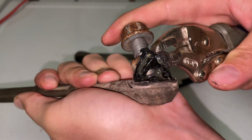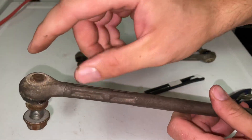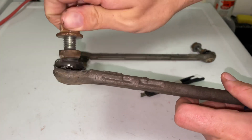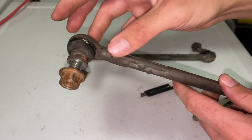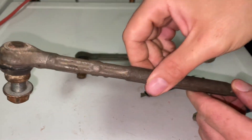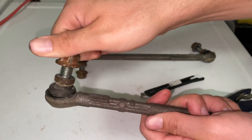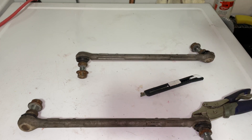This thing is fairly loose. The benefit when you buy a greasable unit — which I would suggest, like what I did — is that it has a grease nipple on the end of each side. You can pump it with fresh grease every year. When I put my winter tires on or take them off and put the spring tires on, I give it a couple pumps, you'll actually see it swell up the boot, and you'll have fresh grease. It'll last a lot longer. Hopefully this convinced you to not buy a factory OEM sealed unit and get yourself a greasable one. Thanks for watching everybody — please don't forget to like and subscribe.